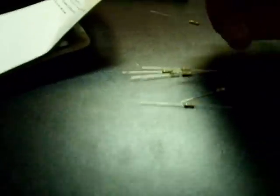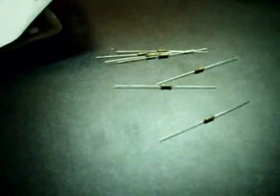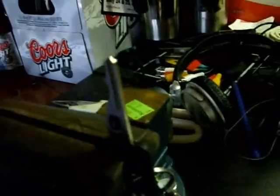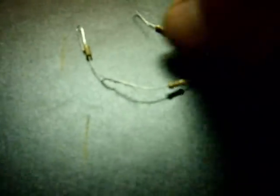Now we take our resistors and put the ohm meter in between them, keep adding resistors until you get the same resistance as you measured on the key. I had to loop together a 100, a 1,000, and a 10-ohm resistor. You have a 2% leeway above or below. Now we'll take the key out of the vise and head back to the car.